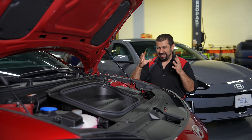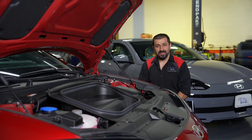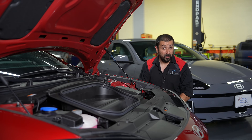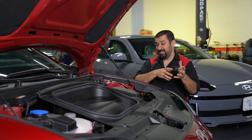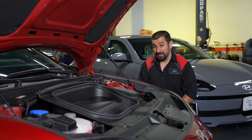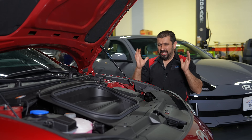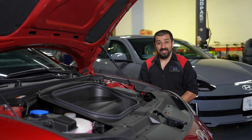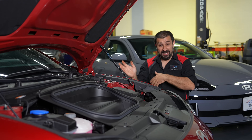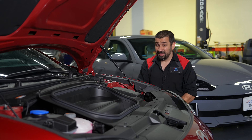The challenge with heating and cooling without becoming counterproductive and killing the range is significant. People say you can just turn on heaters, but that becomes counterproductive very quickly. So they really have to engineer these systems very well. This car uses a heat pump HVAC system. Very briefly, a heat pump is used in both cars and houses — it takes the normal AC and flips it, so the heat goes inside and the cold side is outside.